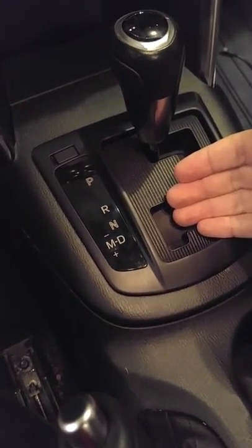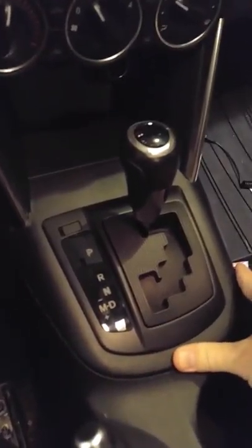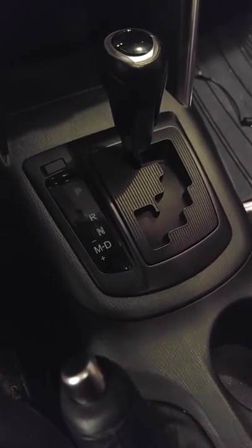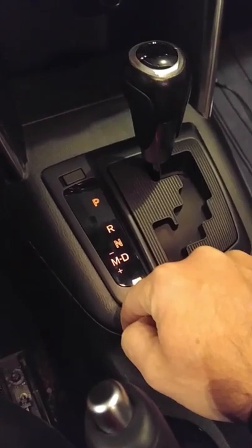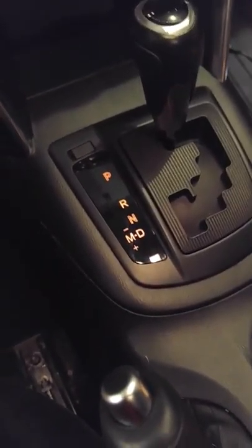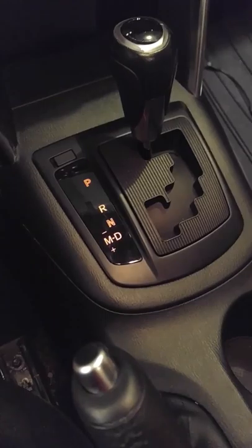It's all back in place now, so I'm going to carefully pop this back down in. Right side popped in, left side, back — it's all clipped back in now, all the way around, secured and stable. Turning the car back on, you'll see I've got lights here again — all my lights are lit up and we've got our problem solved. A $4 Sylvania Long Life 2721 from O'Reilly replaced the Mazda factory bulb that the dealerships wanted anywhere between $10 and $13 for.